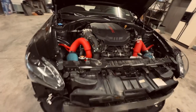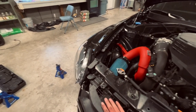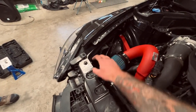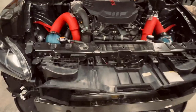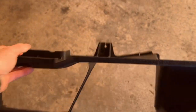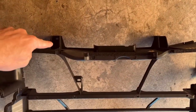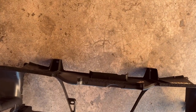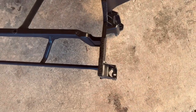That's probably a major reason why this engine bay is so hot all the time — the air is not hitting it directly. It's relying on air to be sucked through here. At the same time, the stock air boxes are sealed so the air is sucking in from out here, so I guess it's not horrible. But for tuning like what we have, this is not good at all. We've got to remove this shroud. When you're looking at the car dead-on you're going to have two bolts up top, then one extra one that holds on the factory snorkel piece, so you have the two up top, one right there, one right there — same thing on the other side.